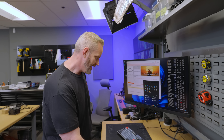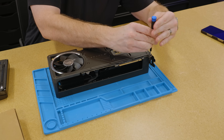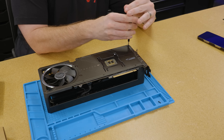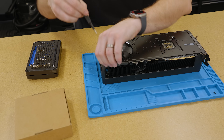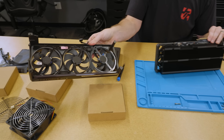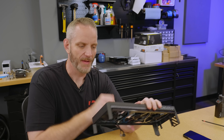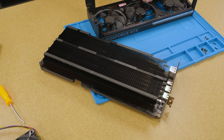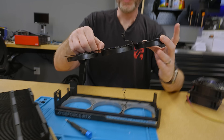Let's tear this sucker down. Here's the cool thing about the Astral card: I can take the shroud with just the fans off and the heatsink part will stay attached to the board. That's why I'm using this card — it's just literally convenient. The fans, RGB, and everything are just attached to that fan frame directly. I could unbolt all these fans from the frame and try to mount the Delta fans to the front, but I don't want to scratch it all up. So I decided to just remove the fan frame and gaffer tape the Delta fans to the outside. The zip tie method is really difficult when you can't go all the way through the grill because the PCB is there.